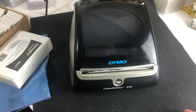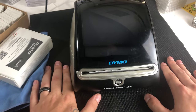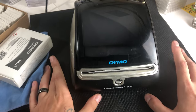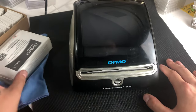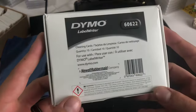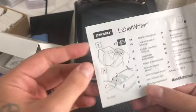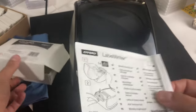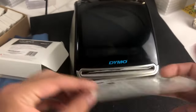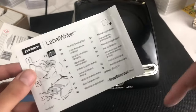The last issue is if your labels are coming out faded or with a white strip missing — almost as if you're running out of ink, though of course there's no ink here. Every 500 labels, we run one of these cleaning cards through it. They're specially designed swabs — you get a box of 10 or 15 and they're fairly cheap, maybe a dollar or less per swab. We've had one box the whole year and aren't even halfway through it, so it's very cost effective. I'll put the link below.